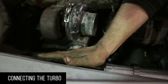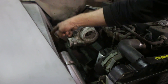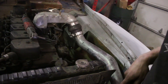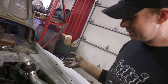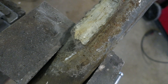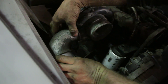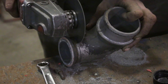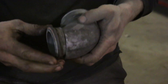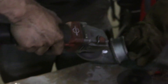The original fender had a scoop kind of built in behind it, but to make the turbo fit and the intercooler piping, I had to cut a section of that out, and I cut the section on this side to try to match it. The intercooler piping that was reasonably priced is on back order and has been for a long time, so I found this piece off a Ford that we grabbed at a scrap yard — it doesn't fit too bad and the customer's okay with that. What we do have to do is make this elbow fit because it's too long, so I'm going to cut a section out of this Dodge elbow, shorten it up a bit — not great for flow but he's not souping this thing up, it's just a VE pump. Let's start TIGing.